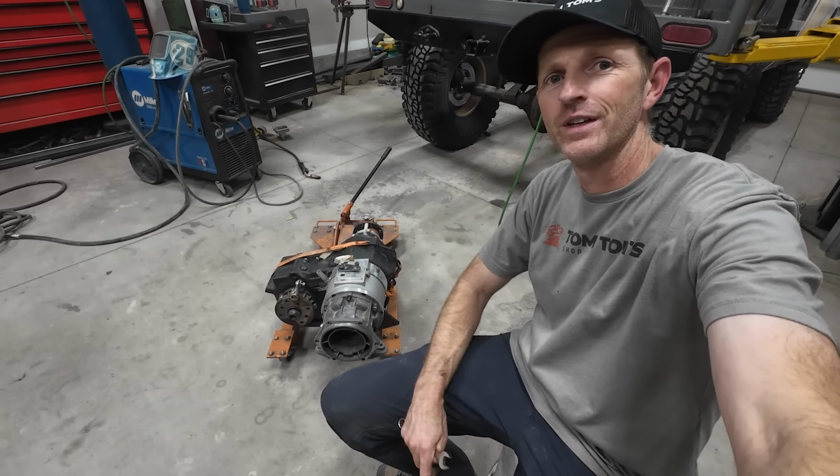Before I put this in the truck, I need to fill it with gear oil, both the doubler and the transfer case, and it's a lot easier to do while it's not in the truck. So this takes 3/4 of a quart of gear oil, which is 3 cups, and this is the only thing I know of at our house that I can measure cups with. So I think Angela will be okay with me using it because she'll understand this is an emergency.